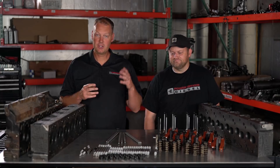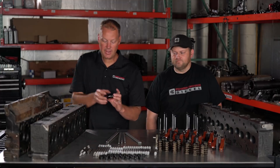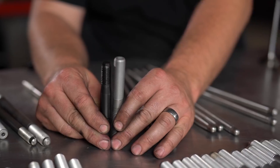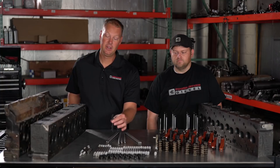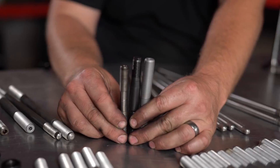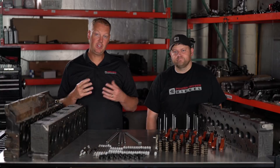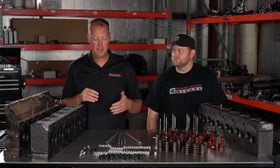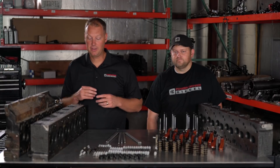Another option for guys on the street would be this stud here. We've had this stud made — still a 14mm in the threads down here, still a 9/16ths shaft — but then we've taken it down to a half inch on the nut portion, so this way you can fit it between your valve covers. This is still stronger than a 12mm standard stud, but not quite as heavy duty as the 9/16ths. So for competition only, where power is the main goal, I like the 9/16ths stud. If you're running on the street and oil leaks are a big concern, the half-inch nut version is probably a better fit.